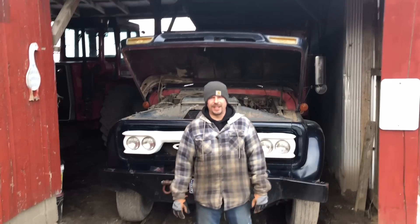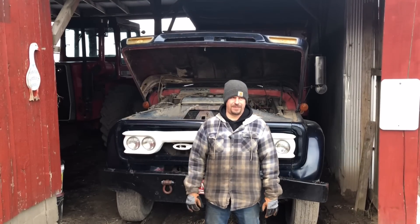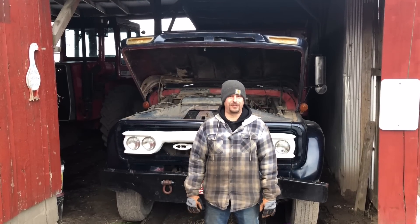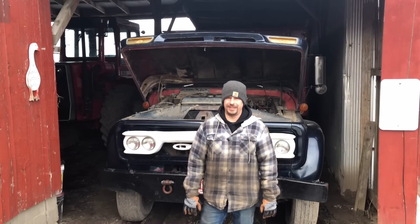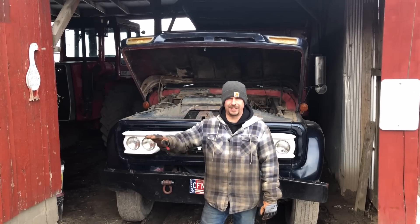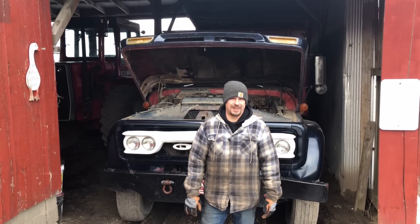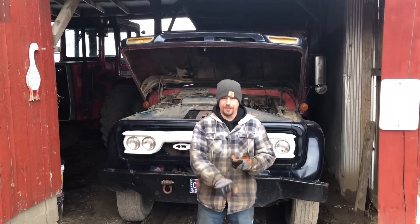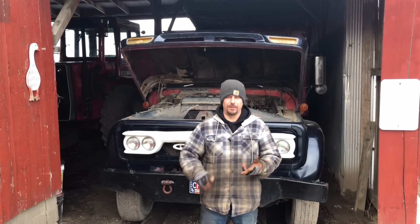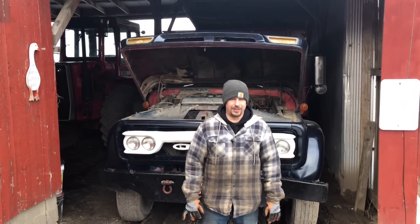Now that could be an arrangement of things. I mean, this is a '64 — not the original motor, but it's still a 401. And 1960 to '66 is about kind of the cutoff for the 401, so she's definitely that old. So who's to say it doesn't have the valve seats pounded out of it, or the rings are wasted? There could be a lot going on with this thing.